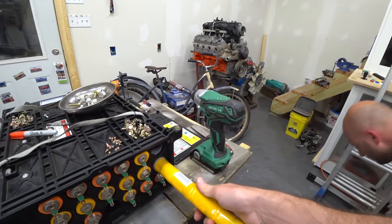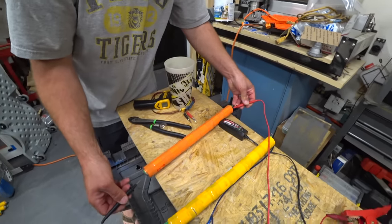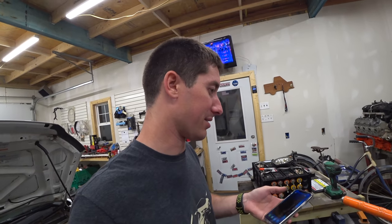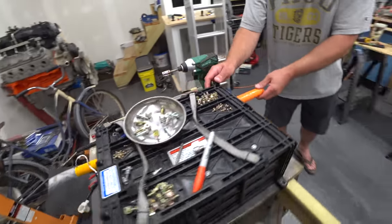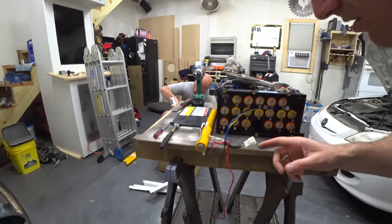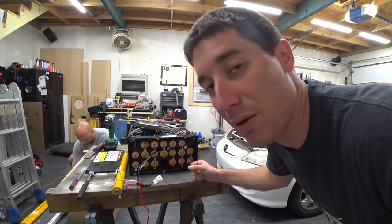Let's see if we have any more oranges — the orange cells seem to be amazing. One orange measured 3.3 volts — not bad at all. I think all the oranges are excellent, much newer cells. When you do this, take pictures of both sides and do not mix them up because if you're wrong it will not go back together. The square end goes in on this side — slide these things in. The temp sensor ones are more challenging: if we don't have any with temp sensors, we'll have to take a razor, cut the tape, pull the sensor off, and tape up a new sleeve. Almost every battery with a temp sensor is trash because they're the ones that were never changed.